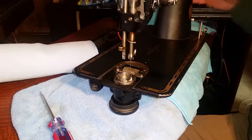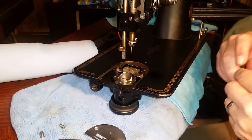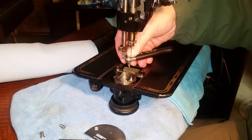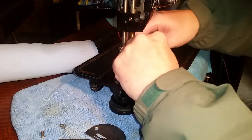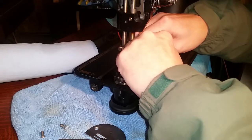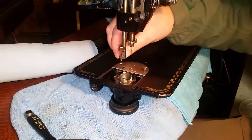That's moving good and quiet too. Your feed dogs are some of the screws you want a little bit of pressure on, because if they back out and get loose you can have sloppy feed or the dogs won't come up. You're not going to crank them way down — give them not even a quarter turn past snug, somewhere between an eighth and a quarter turn. The Chapman Manufacturing 9600 tool kit is pretty much perfect for working on sewing machines.